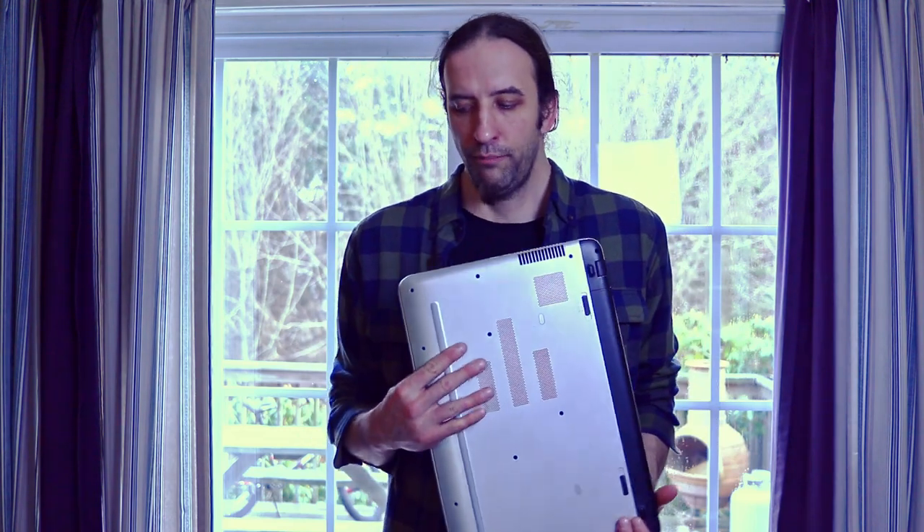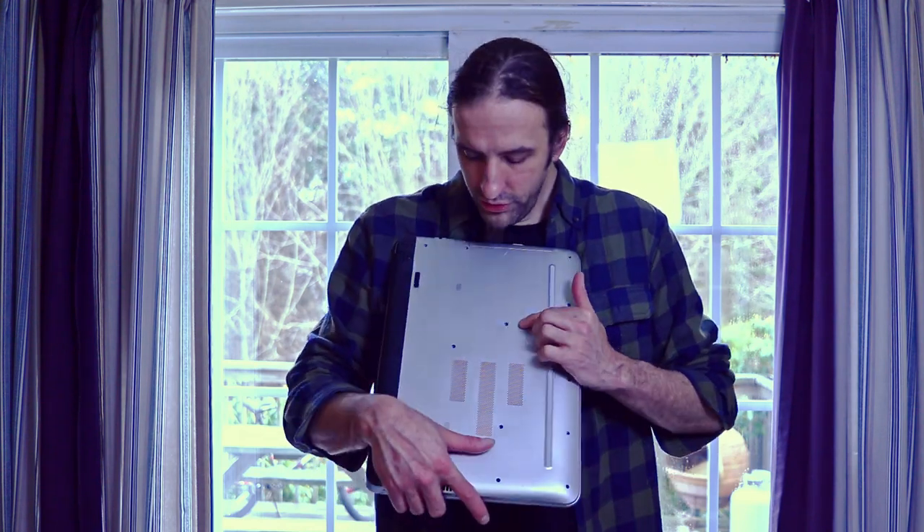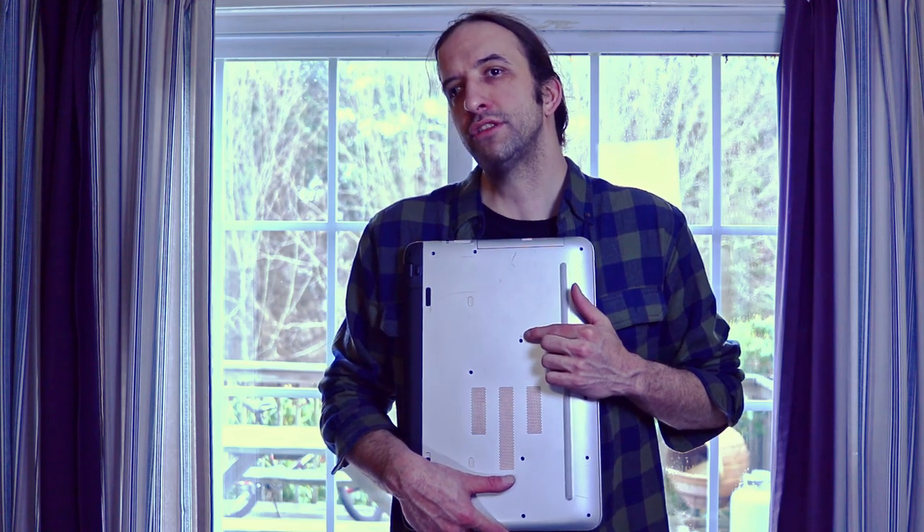So how do we do this? We've got our old relic right here — never going to use it, but it has the DVD-ROM. All you have to do to get it out: there's a tiny little pin right there. You push that and it pops the DVD-ROM open — it's a force open. There's usually one little screw, and you'll usually see a tiny little logo of a disc next to it, meaning that's holding the CD-ROM in place. Once you remove that screw, you can pull the CD-ROM right out. This isn't for every laptop, so look up the manual or teardown of your particular laptop to find out where the screw is. Also make sure your SATA port is the size you need.